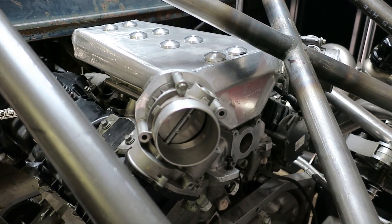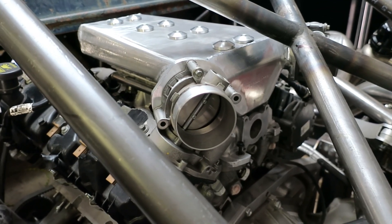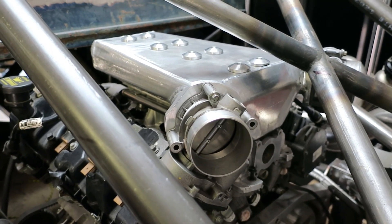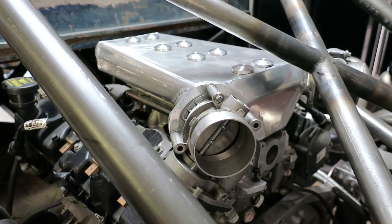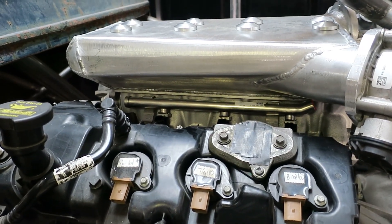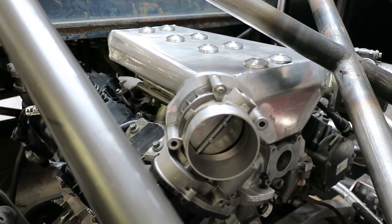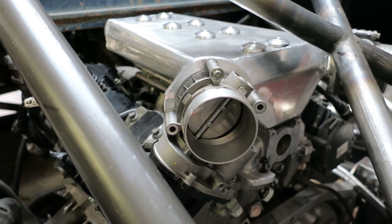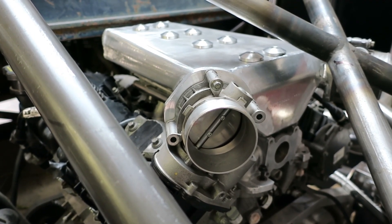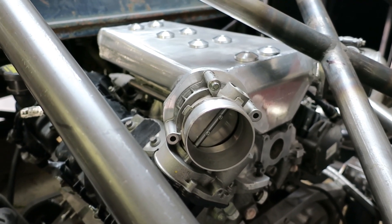Here I've got the plenum and the intake pretty much finished — a little bit more welding to do still. It's got twin 67 millimeter throttle bodies, which are the size off the original EcoBoost engine. There's about one millimeter clearance to the top panel on top of the bed, so it just made it. I've still got to mount pressure and temperature sending units on the plenum. One thing I'm undecided about is whether or not I'm going to put a burst panel on the plenum — if the throttle bodies are closed and there's a backfire, the blow-off valves aren't going to help and the plenum is probably going to distort or burst.